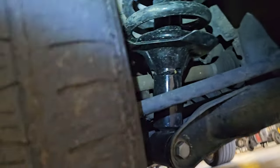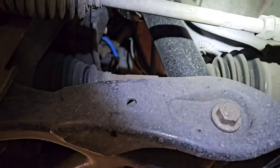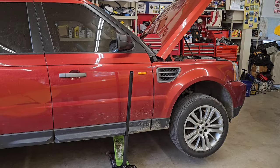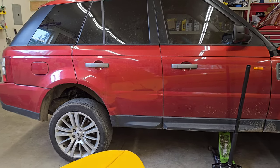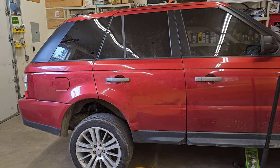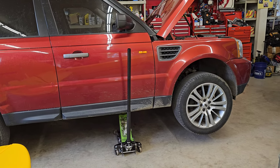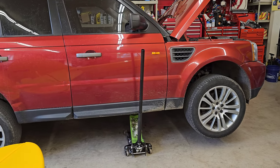Here's a month-later look at the rear suspension — it still looks to be in pretty good shape, and it's the same story when you look at the front suspension. It still retains a very respectable amount of suspension travel with the regular springs, not quite as much as the air bags had. But you can also just lift it up with a hand jack without worrying about blowing out an airbag or deactivating anything — you just lift it up, drop it down, whatever you want to do.